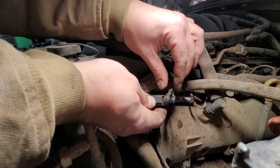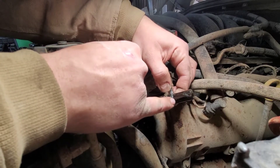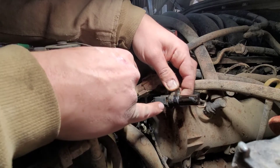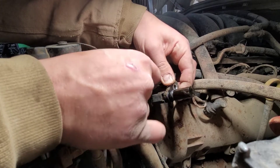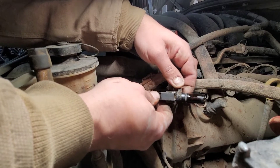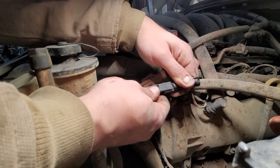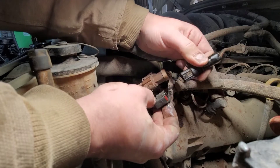So we've got our sensor out. What had happened is that oil residue leaked past the O-ring and got all over everything. You can see the build-up where the spray didn't reach — it had built up all inside where that clip is, full of dust and dirt, basically a caked muddy mess. So when you push the release tab, it wasn't doing anything — it had nowhere to travel. Now that I've got most of that cleaned out, you can push down on that and slide the old sensor right out. Pretty simple job.